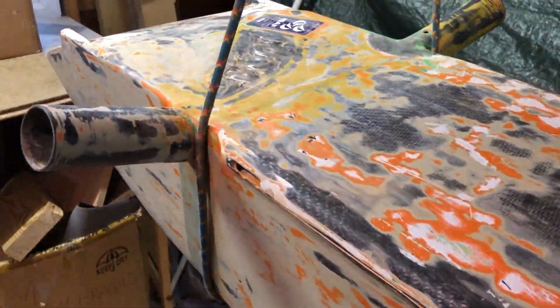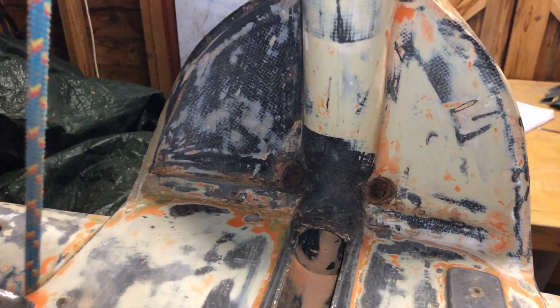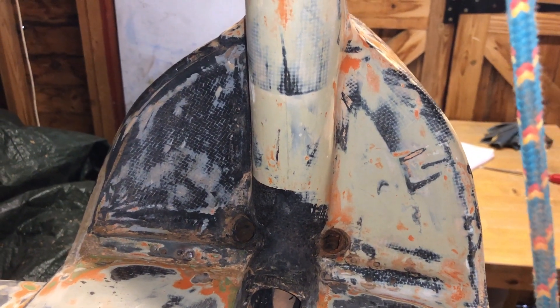I've just finished sanding the boat back, ending up at 240 grit in the wet sandpaper, and I think that's given quite a nice smooth finish already. Before painting I'm going to go up to 320 grit to make it really smooth so the paint flows out nicely. Before we get to painting I've got some repairs to do: around the king post area of the bow I've got some delamination to sort out, and on the bottom of the boat I've got a couple of spots that have gone a little bit soft that I need to dig out and repair. There's also some filling and fairing to do, mostly where the carbon weave has started to come through as I've sanded down, plus some low spots. I want to make sure the boat is really smooth and faired so that when we put the paint on nothing comes through.